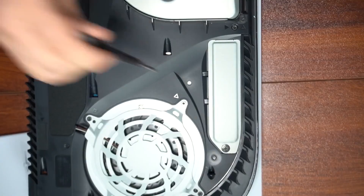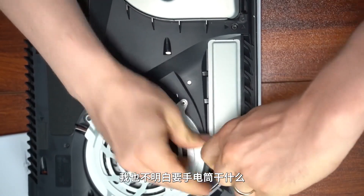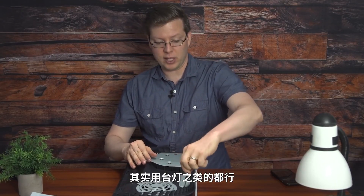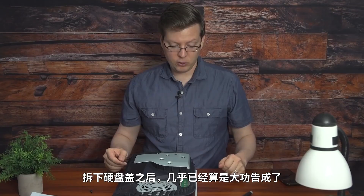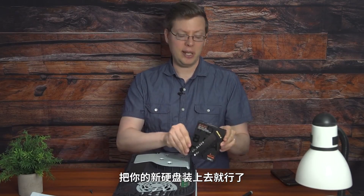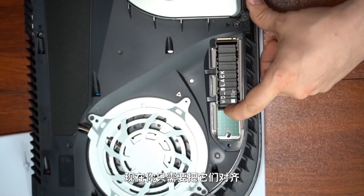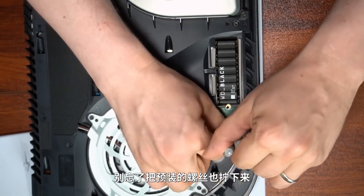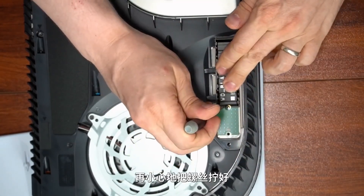We'll set aside the plate and let's open that up with our screwdriver. They say you need a flashlight, but I'm not really sure why — just have it just in case; you could use a desk lamp or anything, really. So once you've gotten your plate off for the hard drive, you're almost done. Open up the hard drive that you've gotten and put it in. Line it up, undo the included screw inside of your PlayStation 5, line up the washer, and then screw it securely in place.